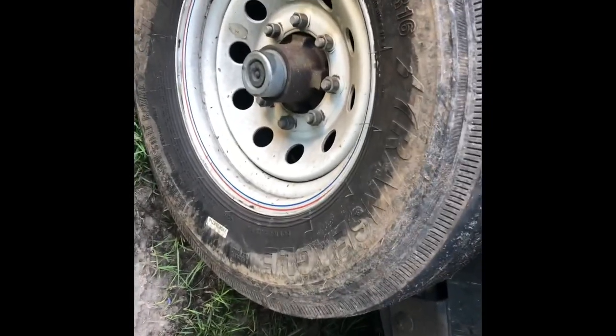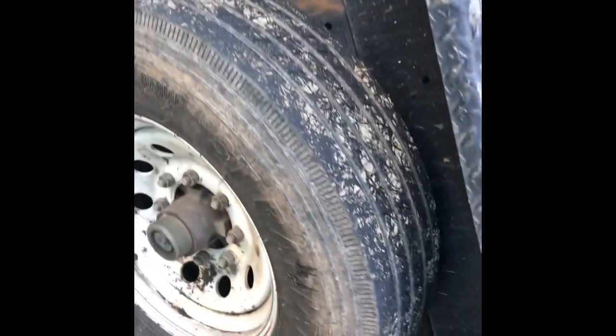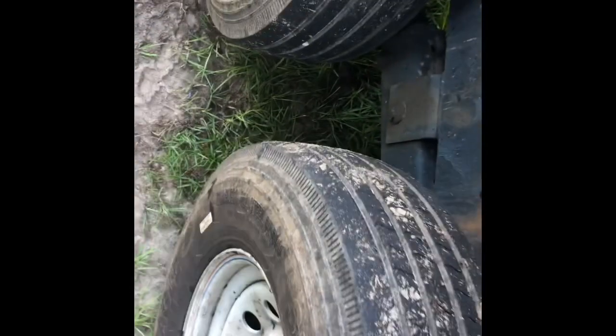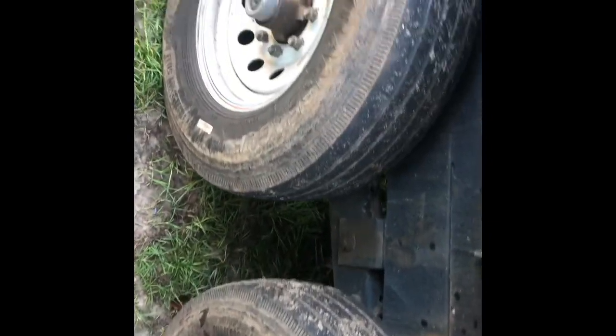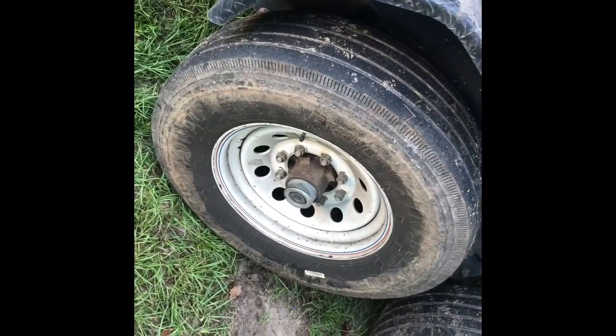Take a look at the tires as well. This trailer has a lot of weight, and the minimum you want to run are 12-ply tires — go ahead and spend the money on good ones. Check them for dry rot, kick them a few times. Every time you take it out, inspect it and make sure you don't have any nails or damage. It's a huge deal because you can't run car tires on these — they just don't hold up to the extra weight.